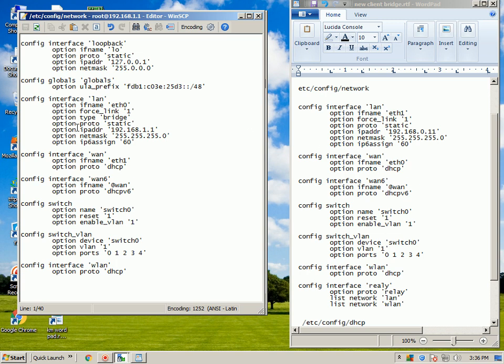Now look, everything's the same except for two things. On the DIR-615 D-Links, my firmware is saying I'm using the switch, eth0, Ethernet switch 0. But these configs are coming off one of my TP-Links, and this option interface name is Ethernet switch 1. So all I have to do is switch this to 1, and boom, reboot, instant brick. Your LANs will not work. You have just screwed up, and there you are, all upset, screaming. But leave this alone.